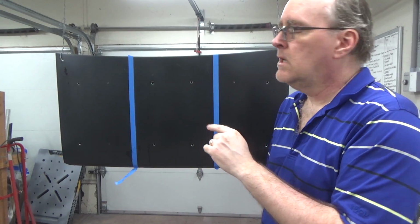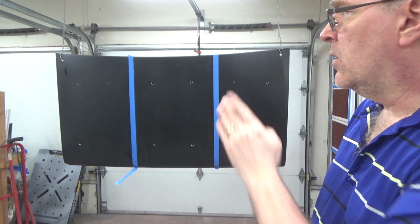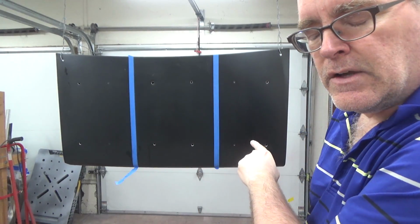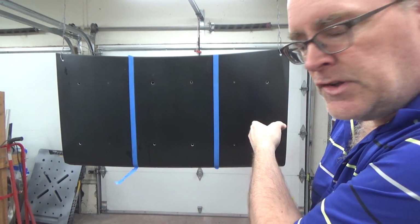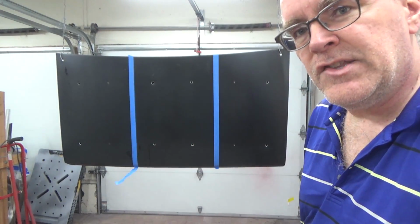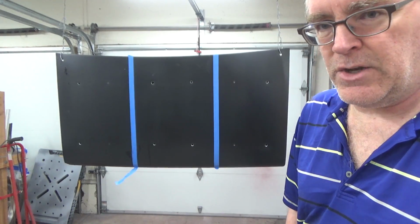We're going to try this Camaro trunk lid here, and what we're going to do is go no accelerator over here, 1%, 2%. The clear coat calls for up to 2%, so we'll try the 3 different stages there and see how it does. We're painting in horrible conditions here. So worst case scenario, basically, it's 58 degrees, it's raining outside, so it's near 100% humidity in here.